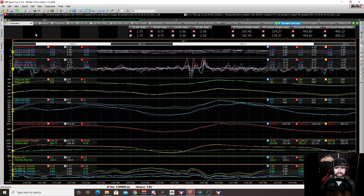There are situations where I will play around with it some, because I used to have a basic rule: Limaland and smaller, 30 degrees, everything bigger, 24. Now I have tinkered with that some and played around with it. Saw some gains and also saw some loss. And so I'd always just kind of done 30. There are situations where I've tried others, but for the most part, I've just done 30. And if I did do a less wing angle in forward, it would basically be for qualifying, and by the heat race I had already moved it back. So stability on the smaller track had always seemed to really help.